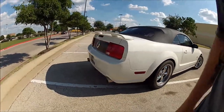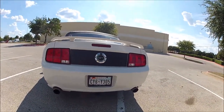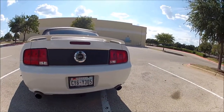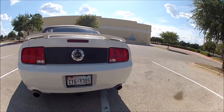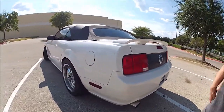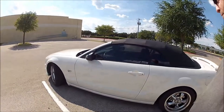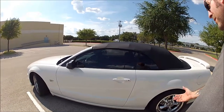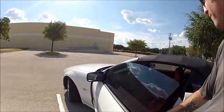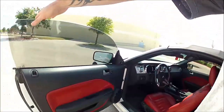I have a trailer hitch, which I'm surprised how much drama I've caught over it — but that's how I tow my dirt bike or my supermoto. I used to have Flowmasters, or as I'll call them, drone masters, because they drone really bad. But they would not work, and neither would the stock mufflers with the trailer hitch. I had to get a muffler eliminator-type resonator. So I got these pipe bombs, which is just an empty pipe that resonates like a glass pack. I also have Pipes M80 glass pack resonators mounted just in front of the rear diff to help quiet the car down a little bit. And I did high-flow catalytic converters to try to calm the car down. It's still quite loud — it just sounds really mean.